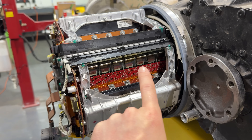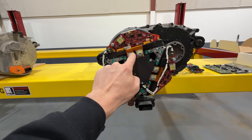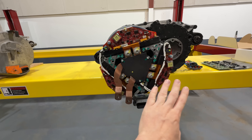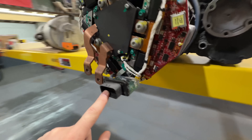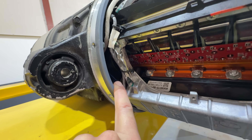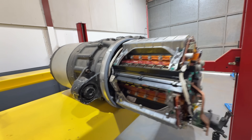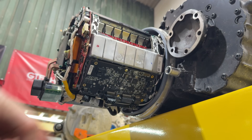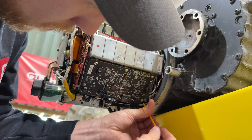These are IGBTs, and there are multiple banks of them within a drive unit. DC comes in, splits into three — one for each phase bank. You then have your low voltage connector going in, which has your throttle, encoder, and all that to plug back into the new logic board. Once the power has gone through those phases and been converted to AC, it goes through basically three bolts into the motor side to power up the AC motor. We simply bolt the new board in, plug it all together, and then put the cover back on.